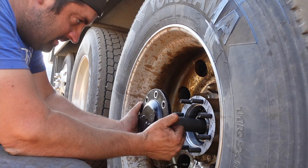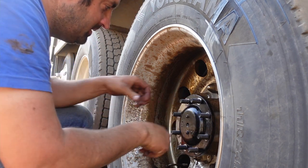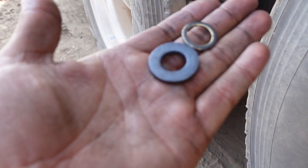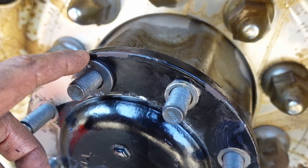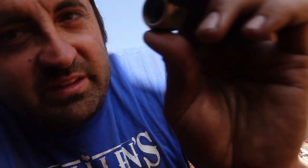In she goes. There may be some discrepancies on why this actually happened but I'm not going to throw anyone under the bus — that's not how I roll. But we are missing a couple of the washers that are supposed to be on there, so we got some replacement ones that are slightly a different size. The nuts that come off of this are nylocks — you can see the nylon right there with the thread cut into it. A new nut does not have those threads — basically when you thread it on it locks it into place. Once you take it off it kind of defeats the purpose, so pick up some new nuts and just do the job right.